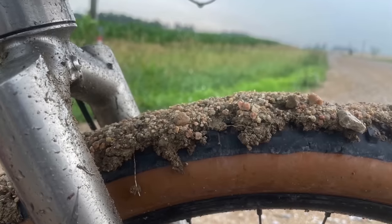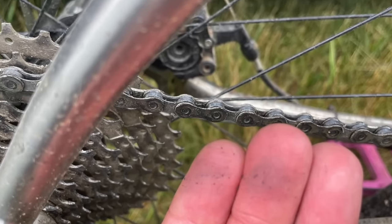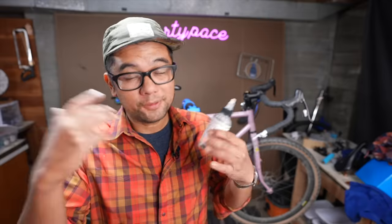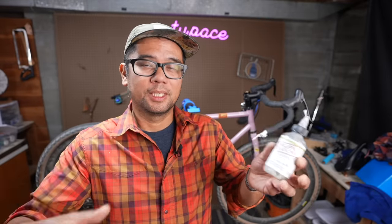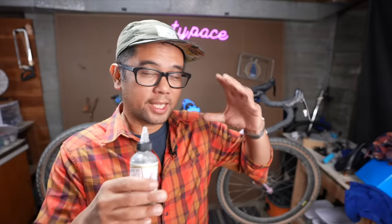I rode the wax chain when we went down to Nebraska — we had a full-on Midwestern storm, lots of rain and mud. At the end of the ride I did a quick finger sweep and you can see how clean the chain was — pretty awesome. Some people brought up chains rusting with wax treatment. If you live in a super wet environment, it's paramount to dry your chain after each ride and reapply the drip wax. If you don't want to hassle with that, this probably isn't for you. We live in a semi-arid environment and mostly contend with dust, and the wax does a good job not attracting more dust since it's a dry lube.